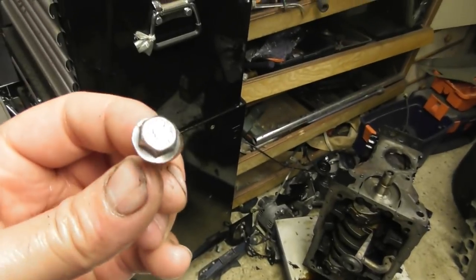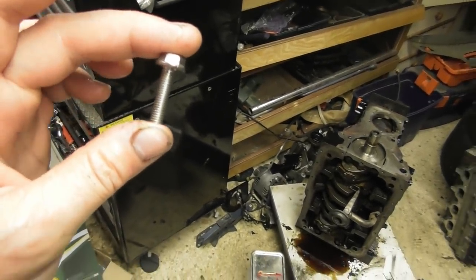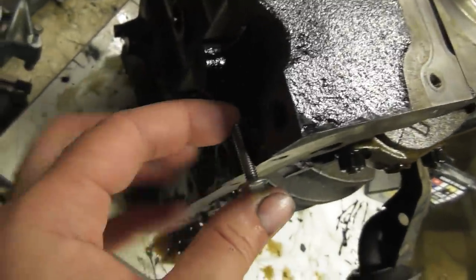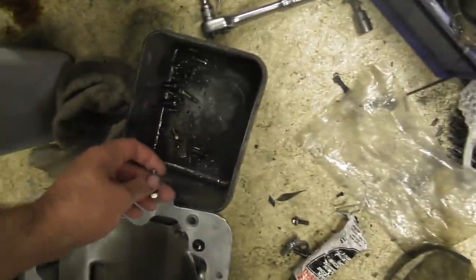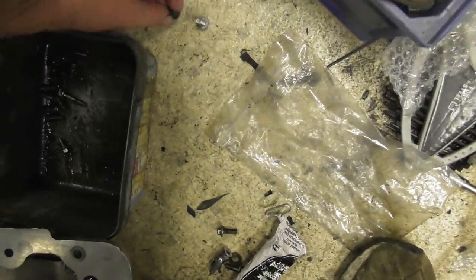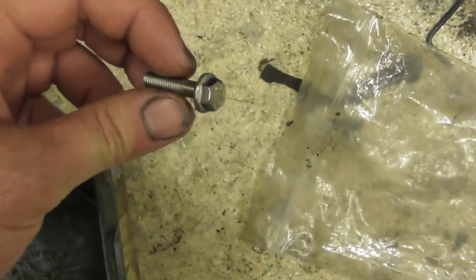I do have some bolts — they're about 25mm long instead of 12 or 13mm which is what the car originally would have had. Longer doesn't really mean much of a problem, it's just that they will stick out and look rather gammy in the block. So basically I need to go and order some more bolts. I could reuse the ones that are in there, but the heads aren't really large enough to distribute the load in the way that I would like. These are bigger than the originals — it's marginal.